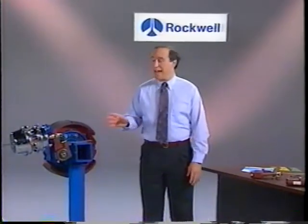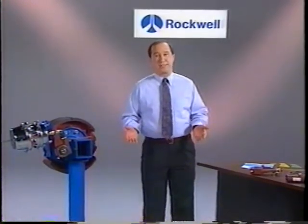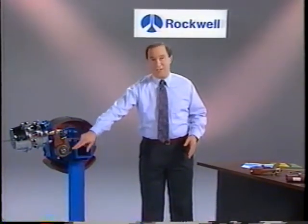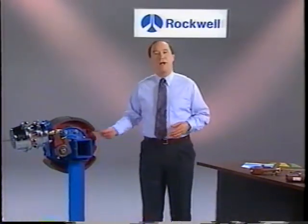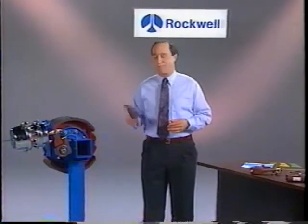Next, we'll discuss ASA selection criteria for different brake applications, including spline size, piston color, and correct slack length. Then, we'll show you proper installation of Rockwell ASAs using clearance and installation templates.